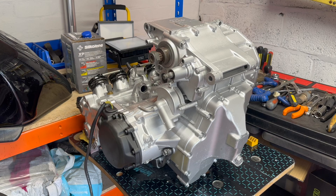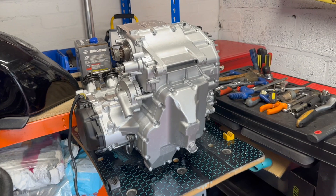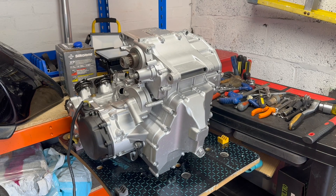I'll show you how it looks. This is how the engine is looking now — it's all very nice and clean, with a nice coat of paint on the end covers and everything is clean and ready to go. As I say, still got the clutch to go. I've ordered from Wiremoto the 2mm clutch plate so I can discard the extra 2.2mm plate I've got in there and put it in, and we're all ready to go back into the frame.